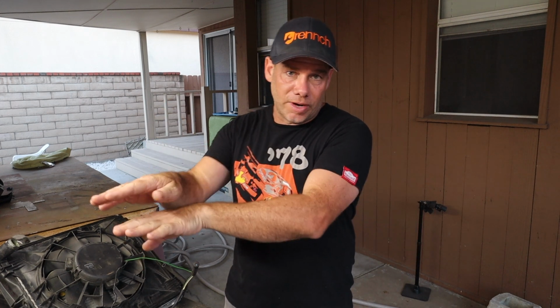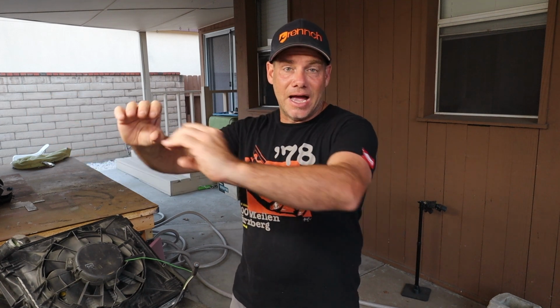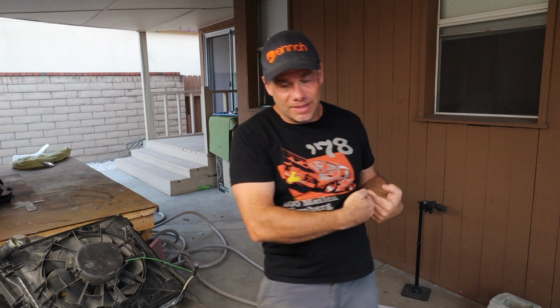So what I've done is I've looked into the Porsche 996. The 996 had dual twin radiators. It had lines going through the tunnel. And pretty interesting how they ran it. They ran a single 1-inch line for the hot side and another one for the cold side. Then once they got to the front of the car, they split, went to the top, or I suppose the top would be the hot side, drained and cooled down, and then went back to the engine cooler with the 1-inch tube. So it's kind of a parallel thing.